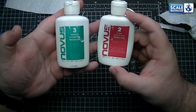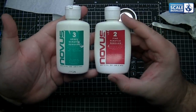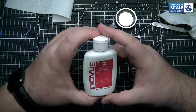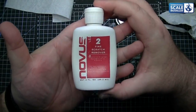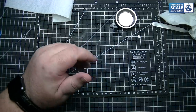Now, we've sanded all the car with the micro mesh, and now we're going to use some compound. So I've got the Novus, we've got number 3 heavy and number 2 fine. We don't need a heavy in this case, it's not that bad. So we're going to come in with the number 2 and lightly polish up where we've just sanded back and bring some of that shine back. You can get the Novus polishes on eBay. Again, if we can find the link, I'll pop it in the description down below.